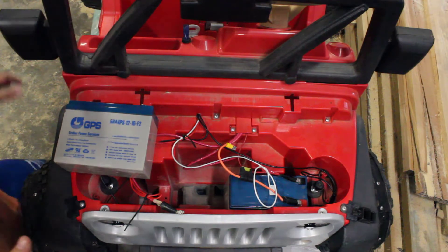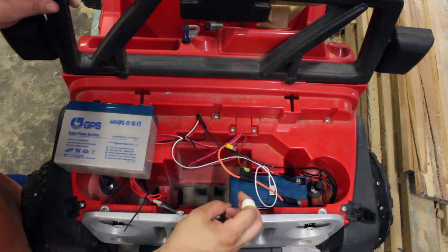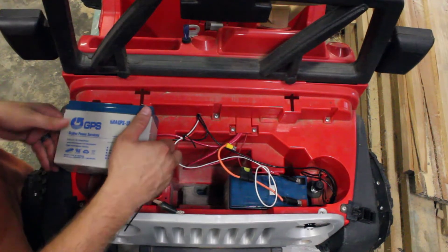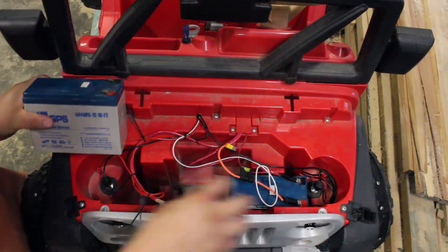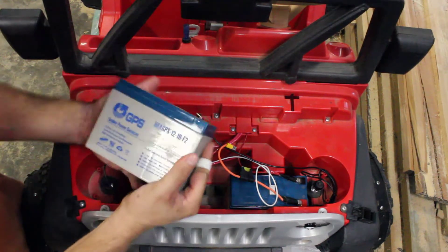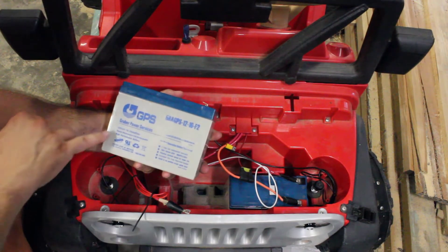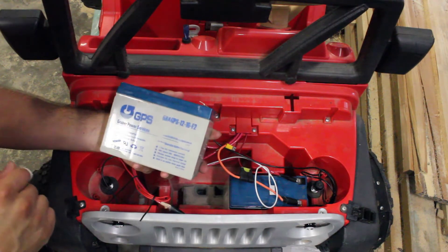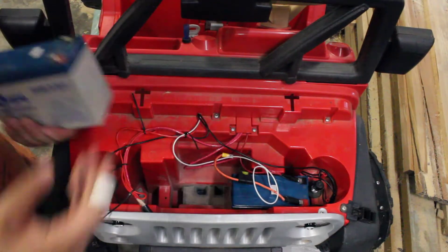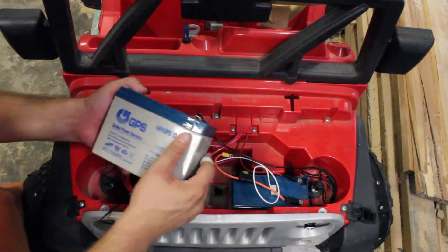The best place to start is the batteries. The original battery fit as a square in here — just the standard one that came with the toy. It died about the same time he needed an upgrade, so I went to two 12-volt batteries. I wanted to keep the compartment mostly the same. I got these from Gruber Power Services — I'll put a link in the description. They're 12 volts, 10.5 amp-hours, and I chose them because of their dimensions — they slide into the compartment without much fuss. I just had to cut out a stiffener piece of plastic to fit two of them.